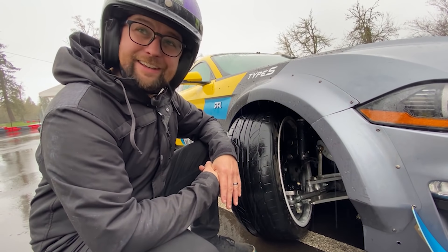Success! It's not every day you get a prototype that bolts right on, minimal adjustment, and is basically ready to rip. I haven't changed anything and I don't know that I would - I might go to the next Ackermann setting to add some more toe-out at lock. But other than that, this thing's pretty dialed.